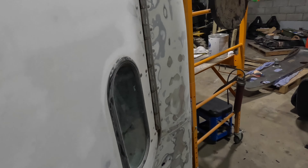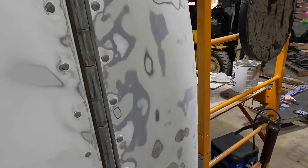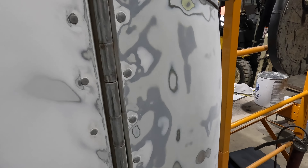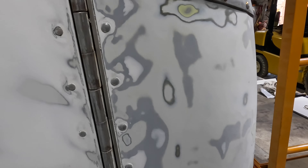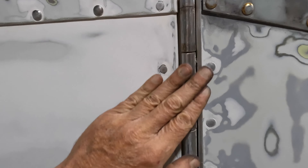I'll go and do the other side off camera. The other passenger's door - I'm not sure whether I've filmed it or not. I had a lot of trouble with it - it'd only get to about here, a good four inches from shutting, and it was pulling on the hinge. Off camera I've mucked around and I think the pillar - well, the mount on the hinge has been pulled, and this one looks the same. It's just starting to flex the back of the hinge there. On the other side I did all sorts to try and remedy it - it was a bit of a mission. Up in here where the slider works with the door, I checked that to make sure it wasn't fouling. Some of these bolts I could see were touching. This door's been opened in the wind and had a big yank - you can see it's been pulled, warping the rods.